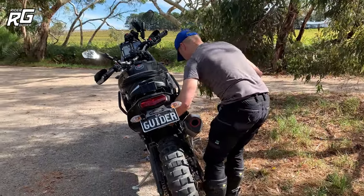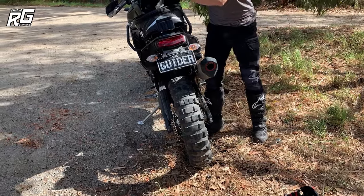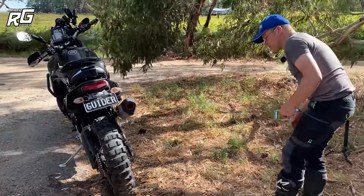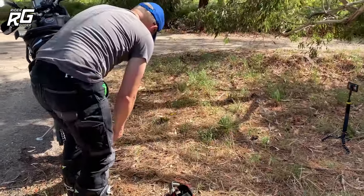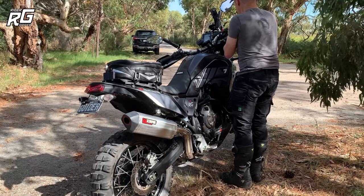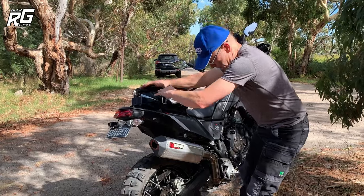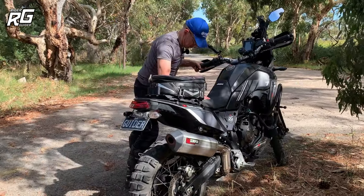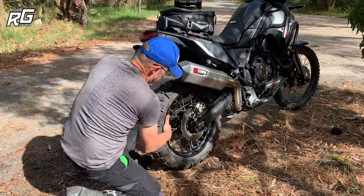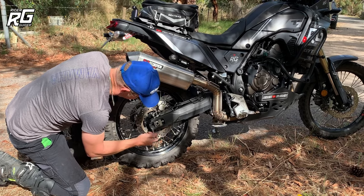Before we forget, we'll do things in reverse — put the spanners out, the 10mm and socket, and go back to the ABS sensor which is tucked out of the way nice and safe. Undo that, run the bolt back in with fingers first, then nip it up. That's it, just a nip — that's all it needs. I've got the wheel and chain back in place, it's spinning. We haven't got the alignment yet so we'll take it back off the stand.